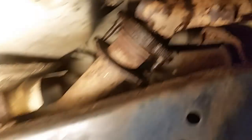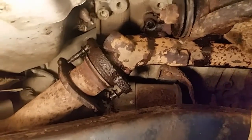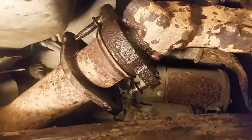There's another bolt in there that's broke off. Part of the stud is still in there, so once I get this manifold off I should be able to get some vice grips and get that off. But regardless, I've still got a couple of bolts here to take off — manifold bolts there on the flange. One of them came off, one of them broke off, which is no problem. I can just take my grinder and cut in here.